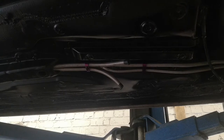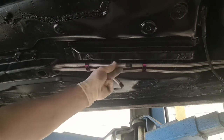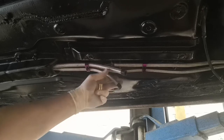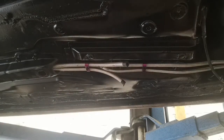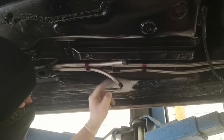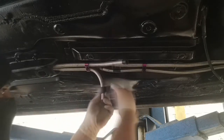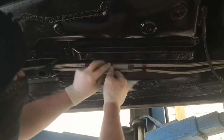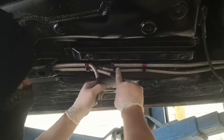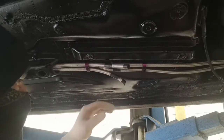I need to figure out which way around to fit it, so I'm going to start off by using some electrical tape to wrap around where I want to make the cut. When I cut it with the angle grinder it just makes it nice and neat - no frayed ends or anything. I'll wrap all four lines. I think I might stagger it, cut one there and leave another where it is, so it just offsets the hose clamps a little bit and stops them being too bulky.